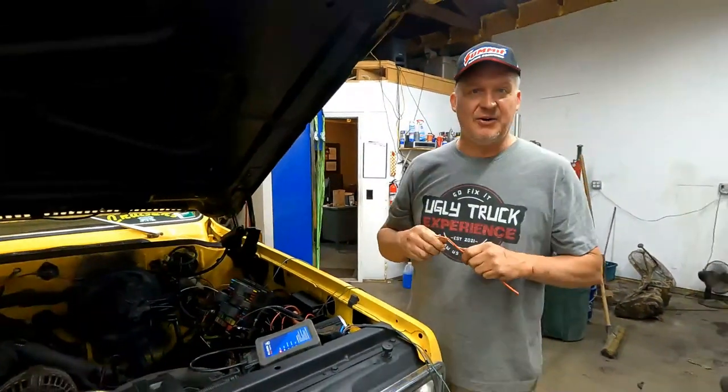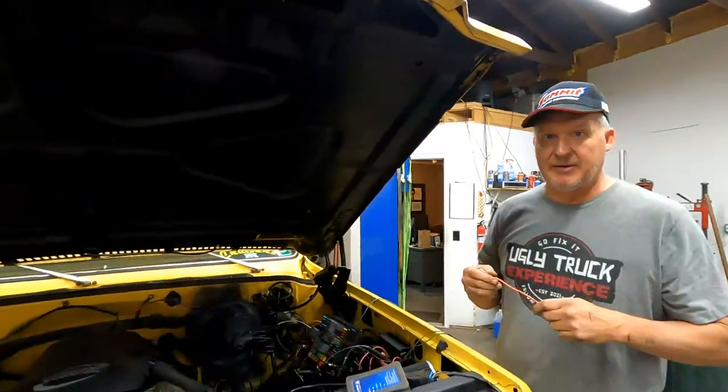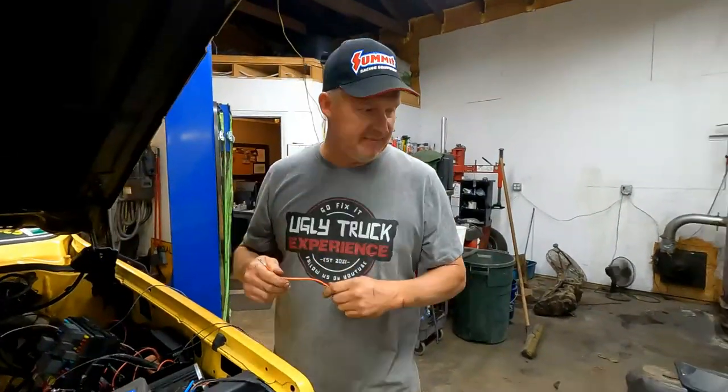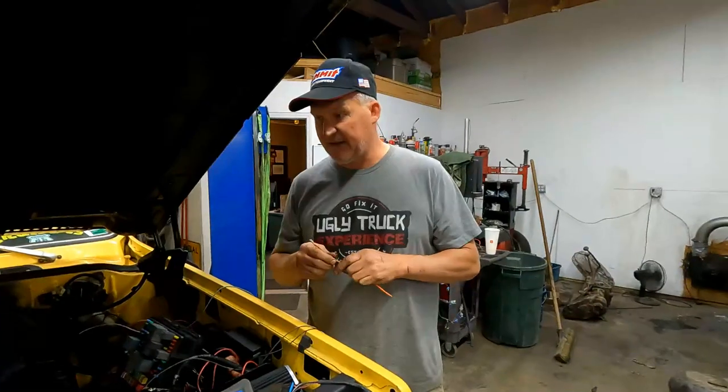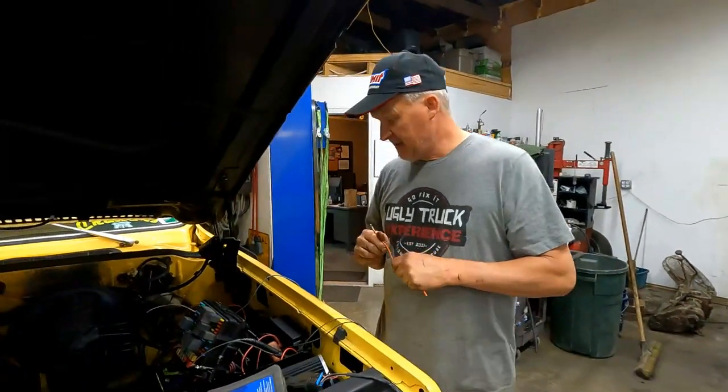All right. It's starting to downpour outside now, so we threw the hood back on this thing. Maybe it'll make the noise a little less, but this circuit runs through the instrument panel fuse box, which you don't have anymore. I don't know why they did it like that, but they did. It's very weird. It's stumped a lot of people, including me. That's one of the greatest reasons for having a wiring diagram for what you're working on, so you can figure out little problems like that, because I would have never figured that one out without a wiring diagram.